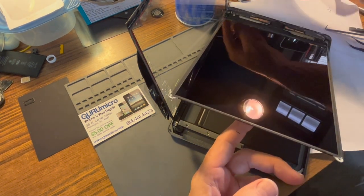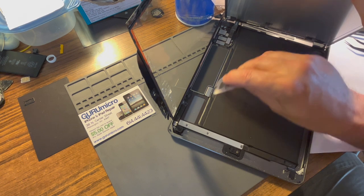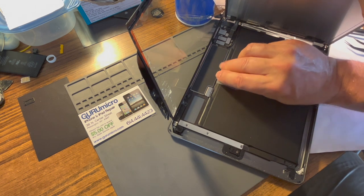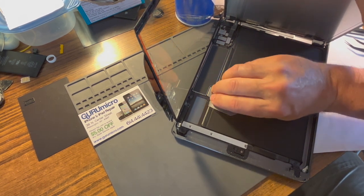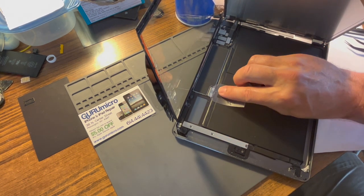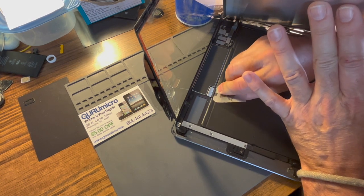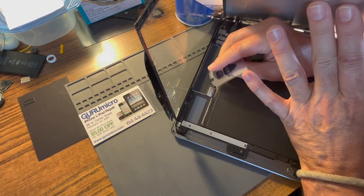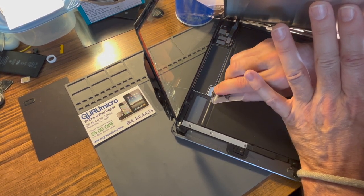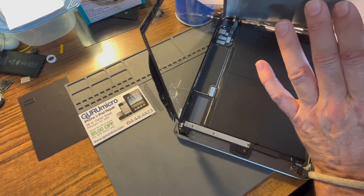This battery block must be plastic. Don't stick any metal pry tools in here or underneath this — you will break something or short the board. I'm going to use the edge of this just to kind of lift the board a little bit first, just to loosen it. I have a notch cut and that notch is going to straddle that screw hole. This part can be a little tricky because I'm trying to hold up the screen and get this thing in here — just be patient. Sometimes I even warm it up a little if it doesn't slide right in.